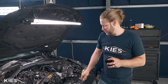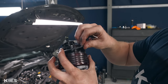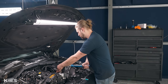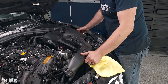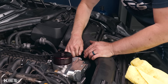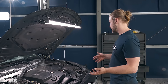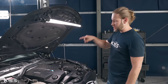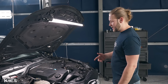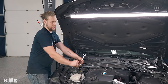Replace the small O-ring and then the large O-ring on the filter cap — make sure the large one seats into its groove properly — then torque the cap to 24.9 newton meters. Install your intake. Now the engine cover is back on and everything else is installed. We need to install the strut brace, try to start the car a couple of times to get the oil flowing, put fuse 165 back in, and then reset the oil light.